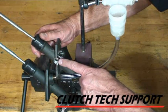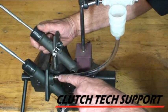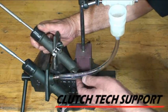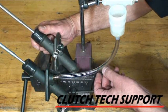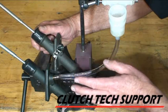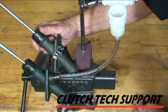But in this case, for this system, mounted at this angle, with the bubble sitting right up there, applying vacuum here very easily pulls those bubbles out, and you can see them through the clear tubing. Dry vacuum bleeding isn't the absolute technique for every system, but it sure worked great on this system.